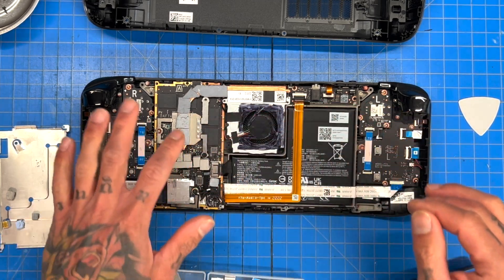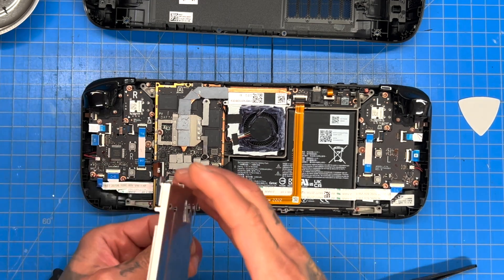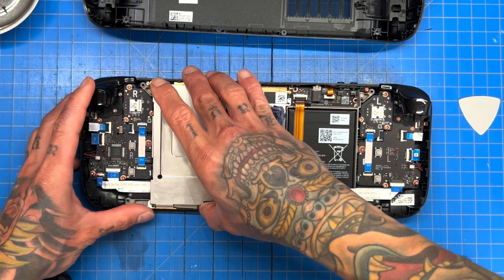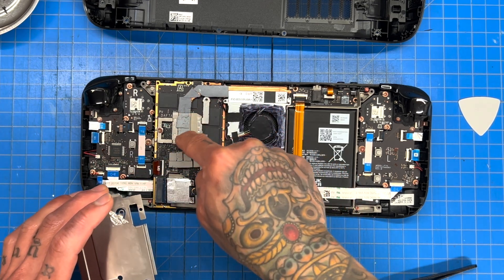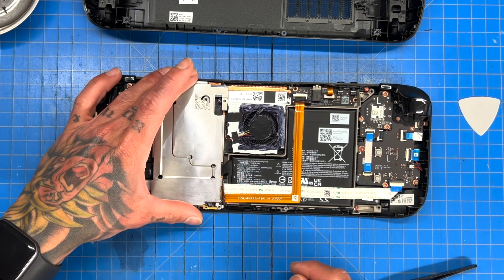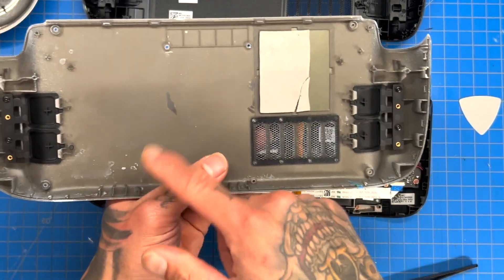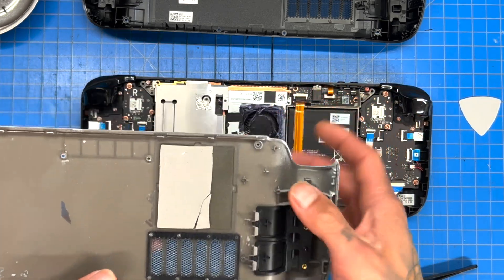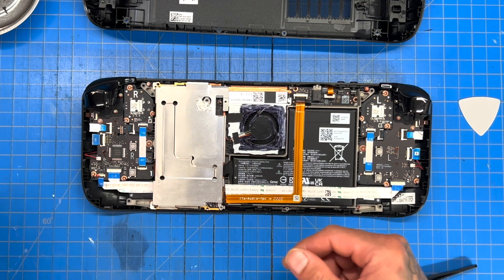That's it — everything else on the bottom you can keep completely stock, or you can keep the APU section stock and only do the heat pipe. This mod was intended to be done with a corresponding mod — whether that's the JSOX backplate. The JSOX backplate ties the heat from the APU, heat pipe, VRMs, MOSFETs, and IC controller down to the heat shield, which then makes greater contact with the back of the JSOX aluminum backplate.